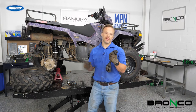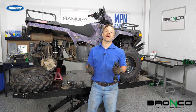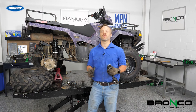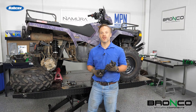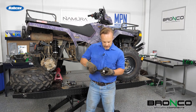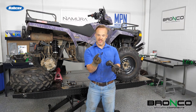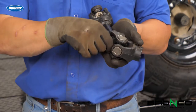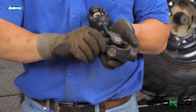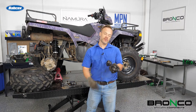On top of that, I typically — when I've gone out for a ride and it gets wet or muddy — will come back and hit these guys again with some grease just to make sure they're filled up. With these Zerk fittings, it's pretty simple: it takes a 5/16-inch wrench. Since these are already threaded, you can start them by hand, put the wrench on, thread it in, then put your grease gun on it.